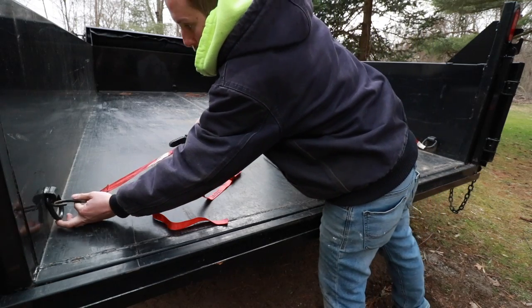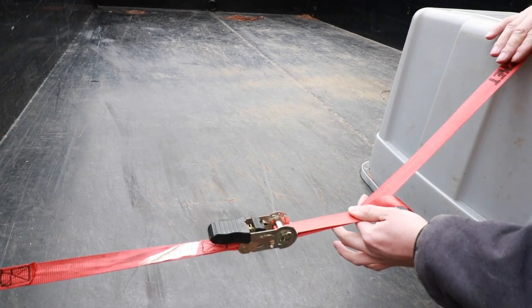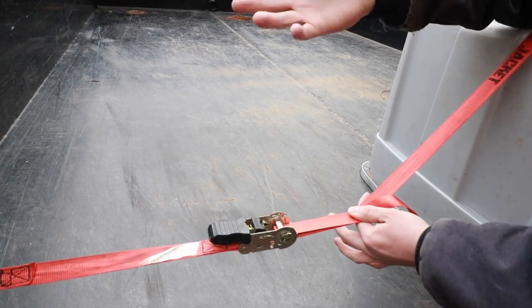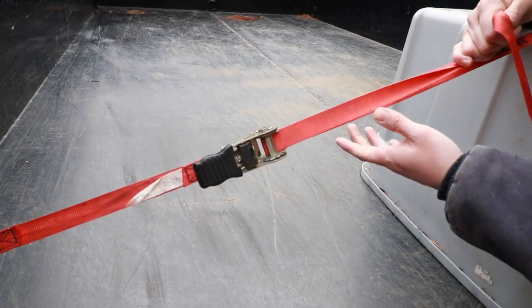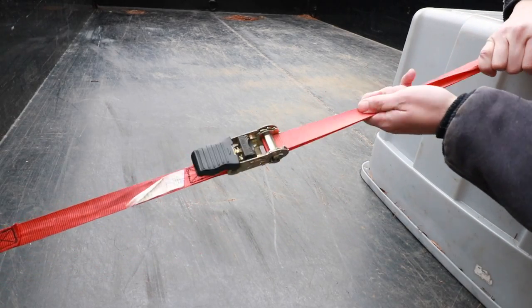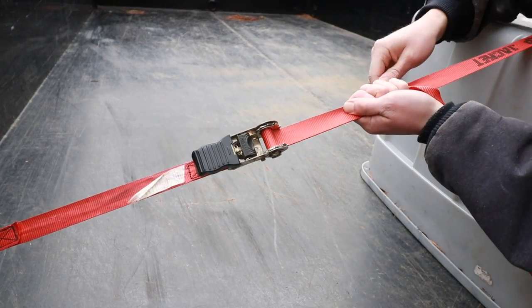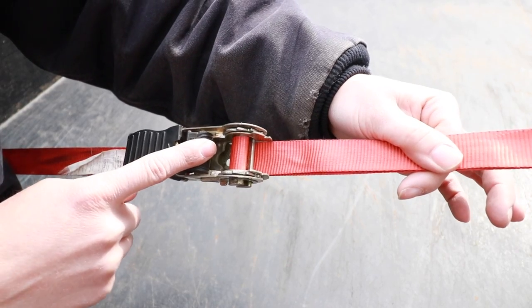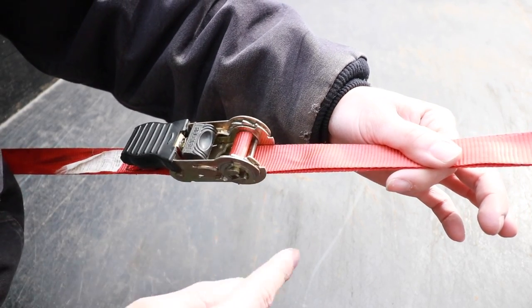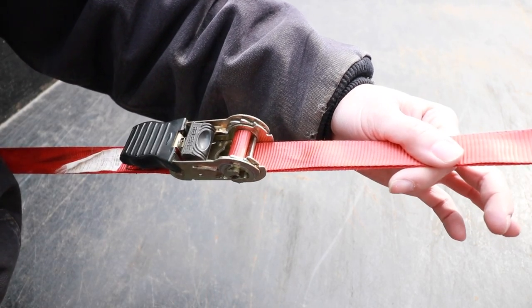Find your other tie-down point, pull back on the slack — we have the ratchet over the load and everything's all set. What most people do is pull up on the loose end of the webbing to get it really tight and then start ratcheting. They're only able to get like maybe a half turn of the mechanism. Take a look at the spool — note how the webbing is not wrapped around the spool at least one complete rotation. I'd recommend it be wrapped around at least twice.